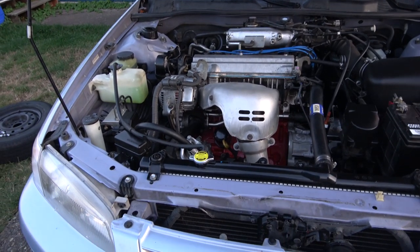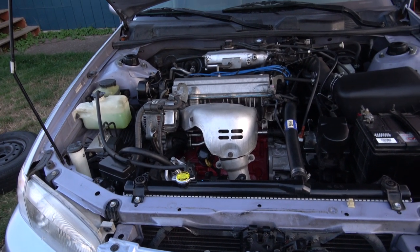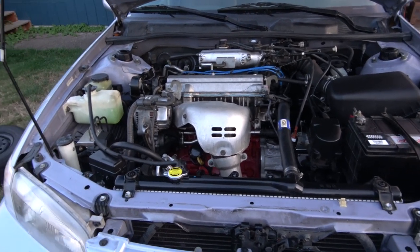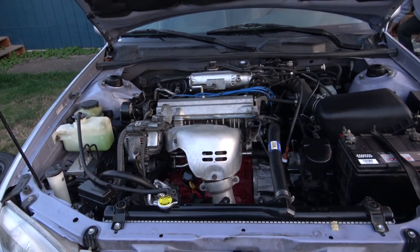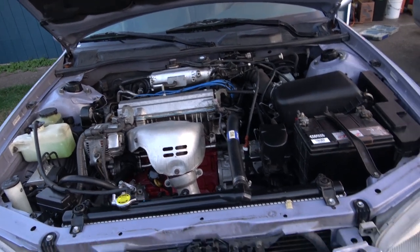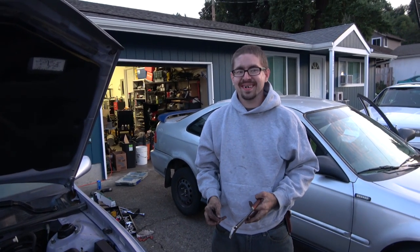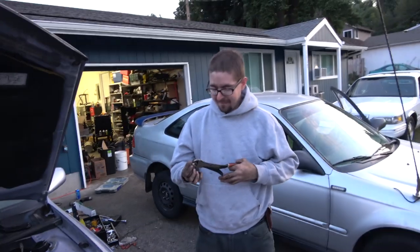We checked the oil, and the oil is crystal clear. There's no metal flakes on it so far, and it's probably ran maybe a total of a half hour. But the plan is to get it fully bled out, get the air out of it, and then once it's at normal operating temp, we're going to let it run for about an hour to an hour and a half. Luckily, before he blew up the motor, he filled the tank. Coincidence? I think not. That's good. Anyways, with that, Johnson out.